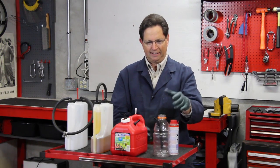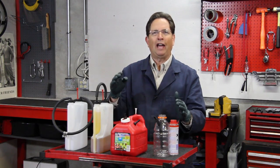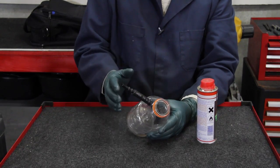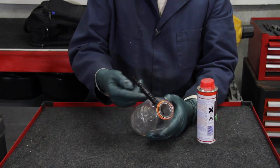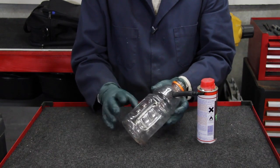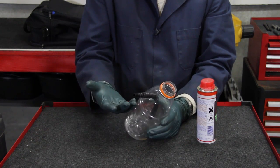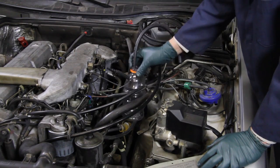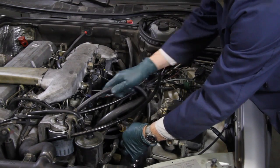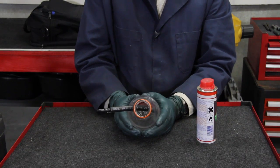Over the years I decided I needed something better. In this video I'm going to show you the steps I went through to arrive at the final new product. The first bottle I designed was solely for the purpose of doing a diesel purge. I just took a large drink bottle, cut a little slit in the top and shoved in a hose where it could pick up the fuel at the bottom of the bottle, then ran the return line back into the top and allowed the diesel purge to run through the engine. It did have a problem — it tended to leak out this hole if you overfilled it, and you did not want to drop this bottle or you would have fuel all over the place.